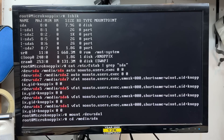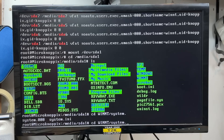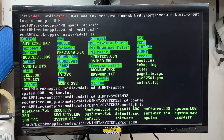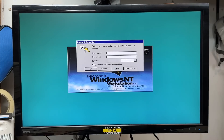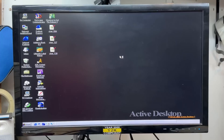I've got to figure out which partition contains the Windows install — I'm guessing it's SDA1 since that would most likely be C drive. There it is. Let's get into that SAM hive. Where is the System32 folder? Maybe it's all caps — ah-ha. Very strange. There's our SAM hive — we'll just run chntpw on that. Let's blank that password, write it out, and reboot. We are in.